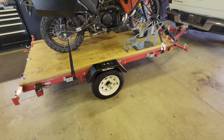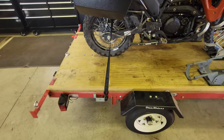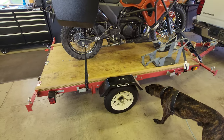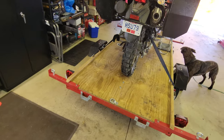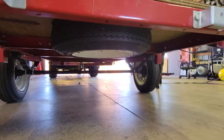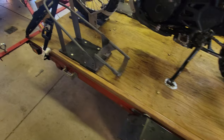The key is to keep the bearings well lubed, keep those tires ballooned up to 50-60 pounds, and check the welds. This is one of those folding-type trailers, and as you can see there's no seam going up the middle of mine — I put a solid sheet of four-by-eight, three-quarter-inch pressure-treated plywood on there, which helps the rigidity. I also have a spare tire mounted underneath as a backup for these little 12-inch tires if one would fail.